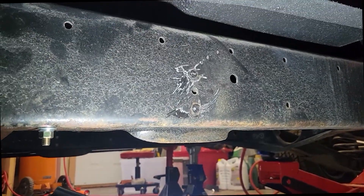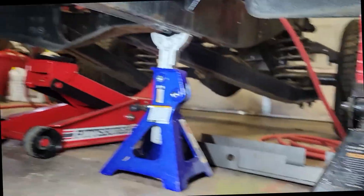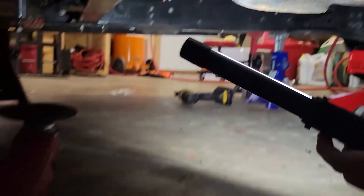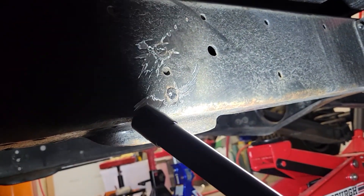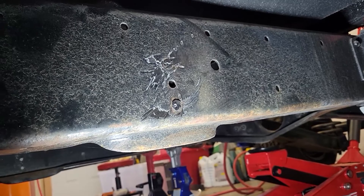About a week later. When you want to cut this frame using the Brothers method, there are some exhaust hangers still hanging here right at the spot where I need to put the template. There were two rivets there which I already started to grind off using the air hammer, but I need to grind them off just a little bit more because the rivets are still kind of overlapping the frame. I'm going to go ahead and work on grinding these off right now.